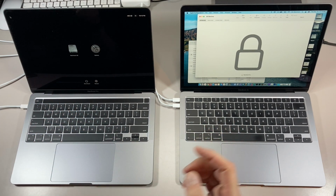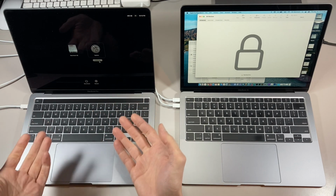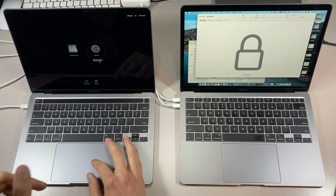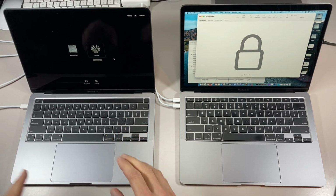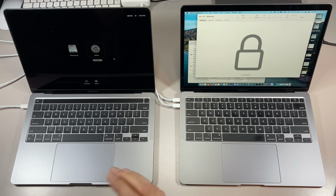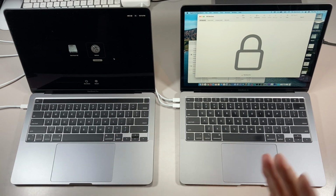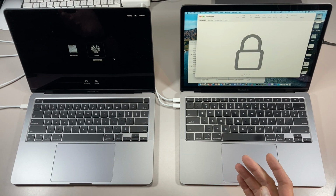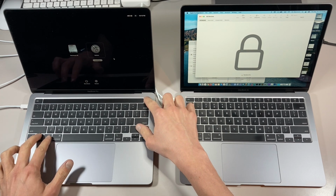And that's it. If you want, click Options and then click Continue, and that'll boot you into macOS Recovery. But again, this is the step we're going to try if you were having trouble getting to DFU mode before. So you see the padlock, you see the recovery menu, you're ready to try the next steps here. So all we'll do is hold down power and then the 3 keys, and we're going to try again.